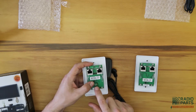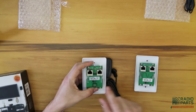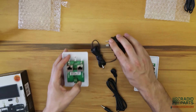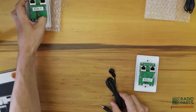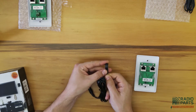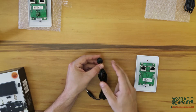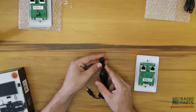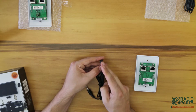There's also the possibility of a 5-volt input at the back into the circuit board. As for how it worked with Foxtel — it actually wasn't the most fantastic. I found the position of the receiver by the TV mattered a lot; it worked best when I had it at an angle, shooting the signal at an angle. When it was front-on it wasn't picking up signal. Foxtel is notoriously difficult with IR, so every other IR seemed to be fine — it's just Foxtel. The Foxtel will work, you just have to be extremely careful about how you position the receiver.